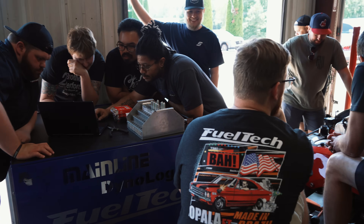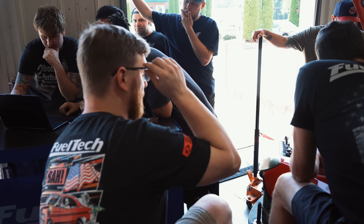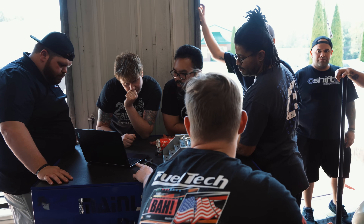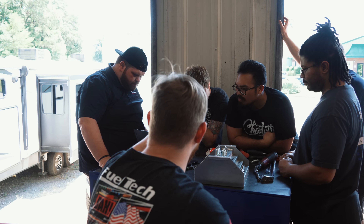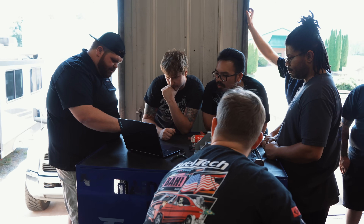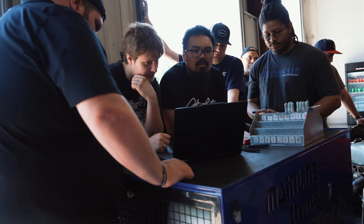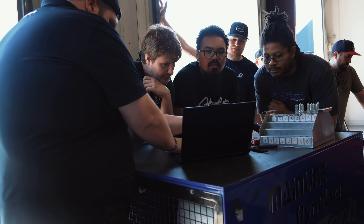I think what that was — the fuel pressure's gone, and the compensation's gone, and all the compensations aren't ripping in. Maybe that puff of smoke at the end... It has a differential fuel pressure compensation, so as soon as the fuel pressure drops, it can up the injector duty cycle. You can still see the O2 starting to run just a little bit up. Boost pressure still super high, engine temp cold. I can put together a pretty good log. The fuel pressure got to 7.